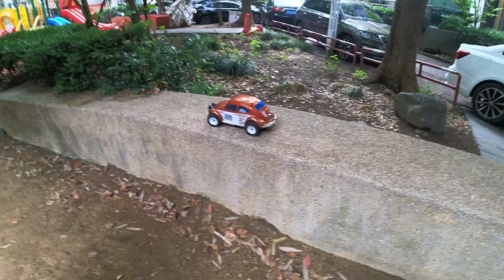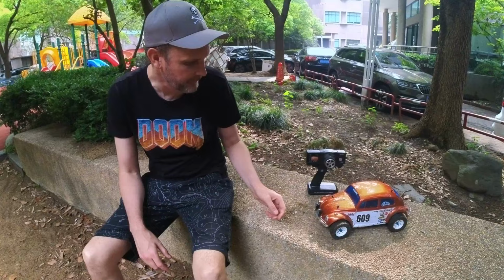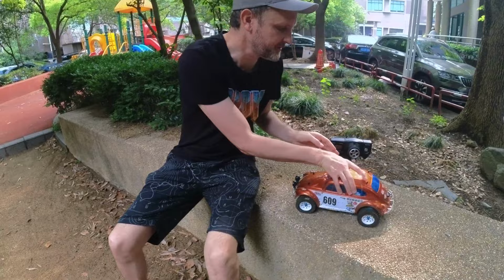Car. All right. Success. We haven't broken it. We've damaged the front bumper a little bit by ramming into things. I need to put a heavier spring set in the front. And fortunately, the racing shocks come with heavier springs. I can also use a different oil. That's about it. The back suspension works great. I think the diffs are still locked up in the rear.